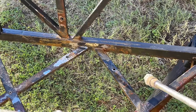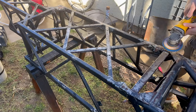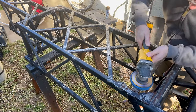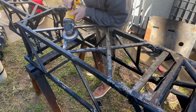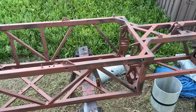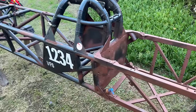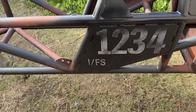It just rusted where the bottom of the car had been dragged along the trailer repeatedly. The engine bay was not quite as good, but it held up pretty well — the places that rusted were where I did a half-assed touch-up job. Steel It: pretty good. Which is good, because it's real expensive. The power washer took care of a surprising amount of surface corrosion, but I did have to go back and sand and wire brush out some rust. I painted the frame with a primer that encapsulates and converts rust, then recoated the whole thing in another layer of Steel It.